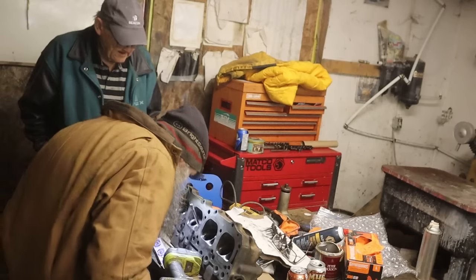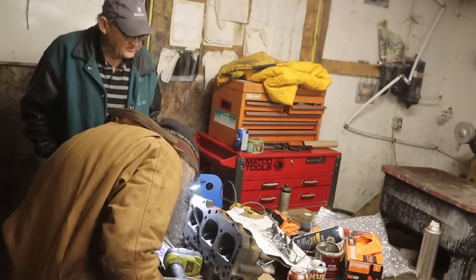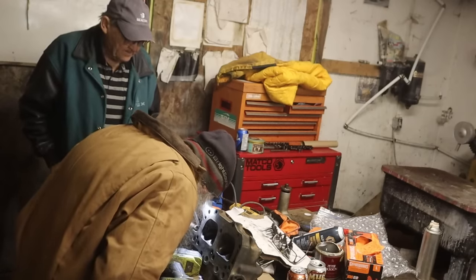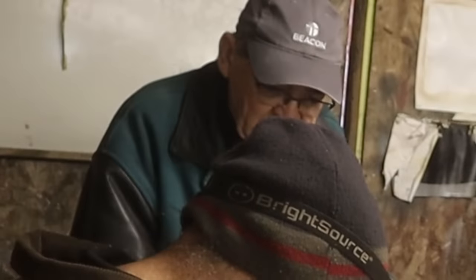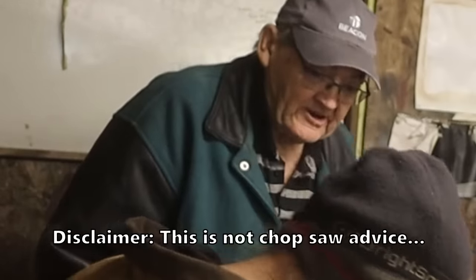Because when they glaze, they do nothing. I know on my cutoff saw, the 14-inch cutoff, you start cutting some kind of metal and you get that glaze on it, and it won't cut tin. Sometimes you're cutting aluminum or something. What I've done, though, is I've taken a pair of pliers and broken little chunks out of it, all the way around. Oh, yeah, but you've got to watch that thing doesn't explode on you. Yeah, you stand off to the side. Otherwise, they'd sell them like that. You've got to stand off to the side and make sure the guard is on, eh?